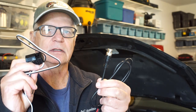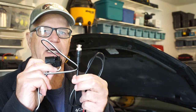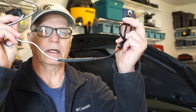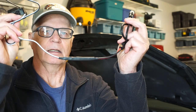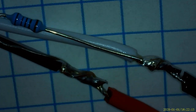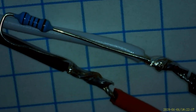It's an easy build. All I've done is taken one of these BNC to alligator clip cables, cut the alligator clips off, spliced it to the output wire of the KC10 transformer, and added a 2 kilo ohm resistor across the leads. Hope you found this interesting and we'll talk to you guys soon.